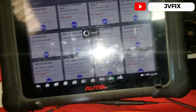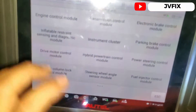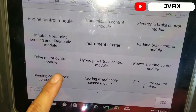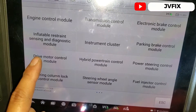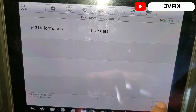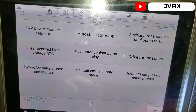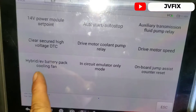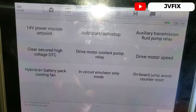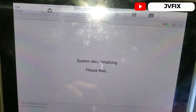I'm going to auto-detect the car on the scanner. I can hear the system running already. I need to find the active test — it's not the Drive Motor Control Module. I'm looking for the fan actuation under active tests. It's the Hybrid Powertrain Module active test — 'Hybrid Battery Pack Cooling Fan.'